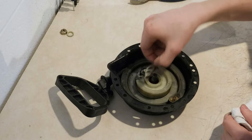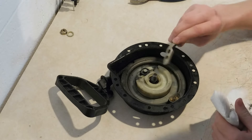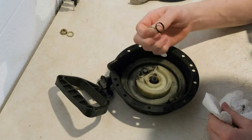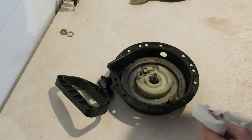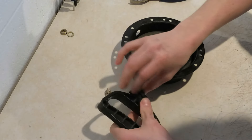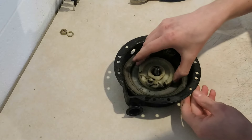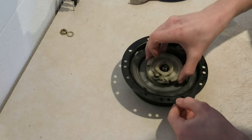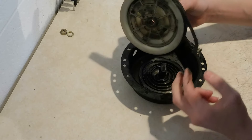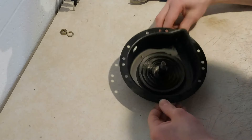This piece right here is the metal pawl that catches onto your starter cup. You can see there's black grease everywhere — that's just what happens. That doesn't look worn hardly at all. There'll be another metal spring underneath there, and then after that there'll be your wheel assembly. But first let's take off this handle — there we go. The rope gets sucked in if you don't tie a knot or something in the end of it, so just go ahead and release the tension on the spring and you'll be able to pull right up on the wheel.